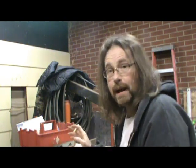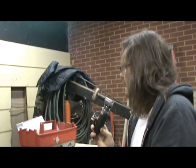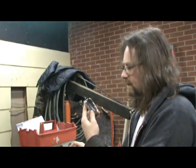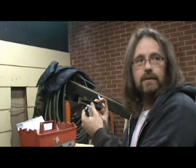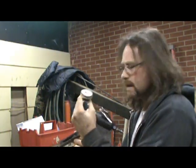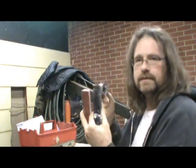As far as the actual polishing process, I use these lambswool buffing pads — buffing wheels, whatever you want to call them. And then you have different grits of compound. You can see I've used into these and they're pretty hard, but it liquefies whenever you put the tool on it — you fire it up, it liquefies and it coats the pad. You just keep going through the series of different grits with that.